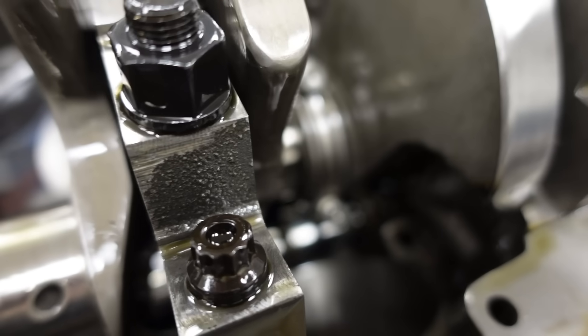It's pretty nuts how much power we were able to gain just by making a few small changes. Same block, heads, cranks, rods, cams, rockers, springs — all this stuff is literally 20-something years old and it just made 791 horsepower. That's why you watch the Engine Performance Expo — we're showing you how to make big power the easy ways. Not everything has to be the trick of the week; sometimes it's about doing the fundamentals. Hone right, ring gaps right — all those little things add up to big gains.